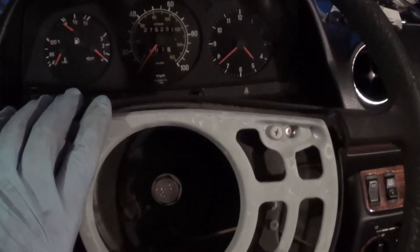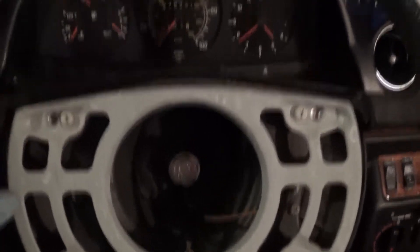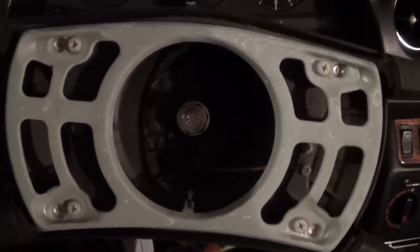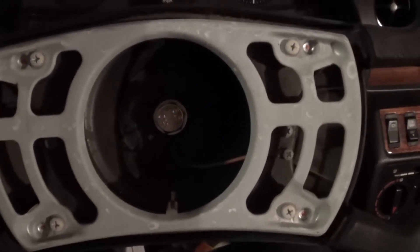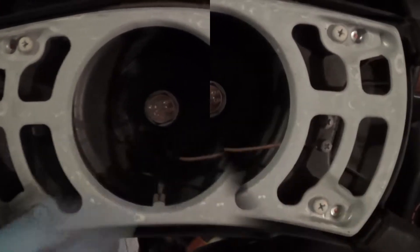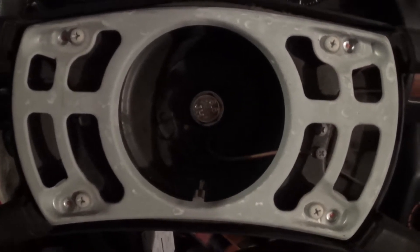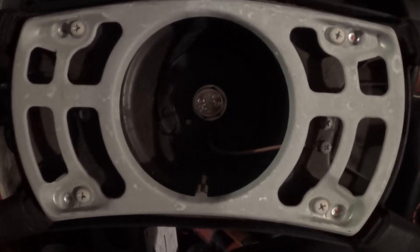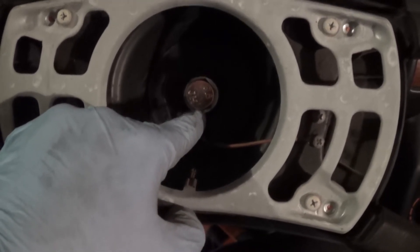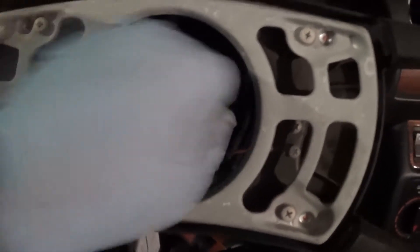You can see here I have the steering wheel once again refitted to the steering column, and that is the new bolt. This is actually the '79 steering wheel, which I figured out I could safely mount to the '83 steering column because the splines on the steering wheel were the same. I mounted the '79 steering wheel on the '83 column essentially the same way as the '83 wheel was mounted, but I used a different bolt — M16 by 1.5, with a 30 millimeter long bolt — and it seems to work nicely.